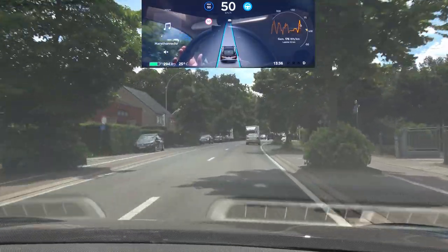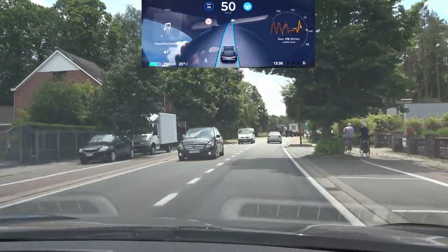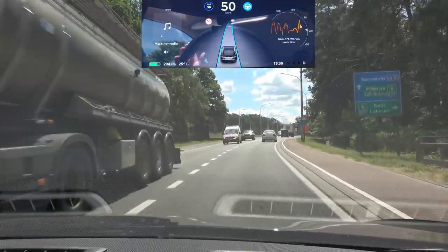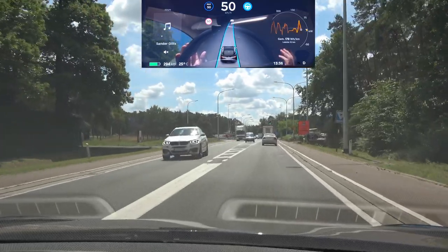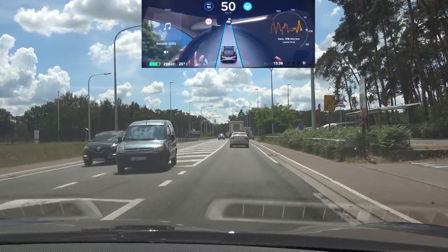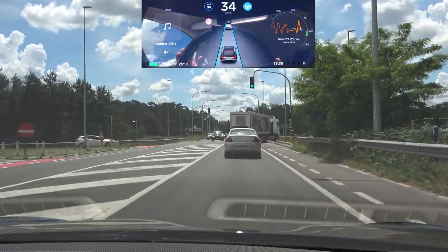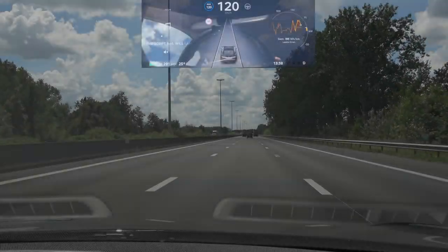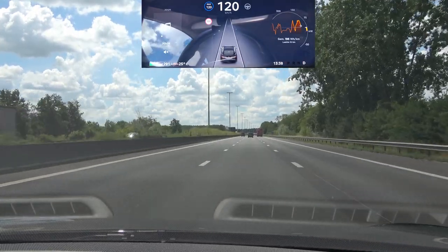Here it's more in the center, not going as much to the outside of the lane — still doing it a little bit, but not as much as autopilot 2. My speed is matched to the car in front of me, so that could account for some of it. But that first part of the turn — because it's not braking — it goes over that lane marking and into the oncoming traffic lane, which is definitely not good.